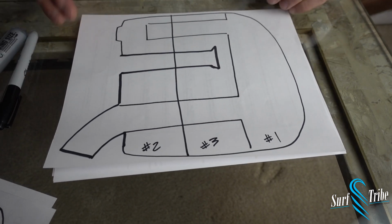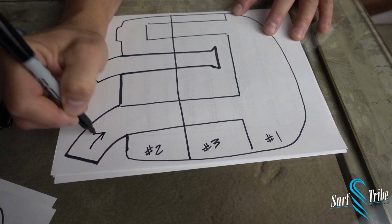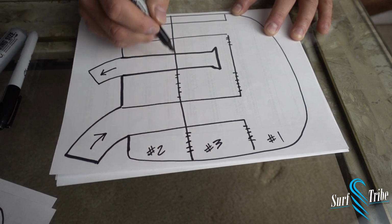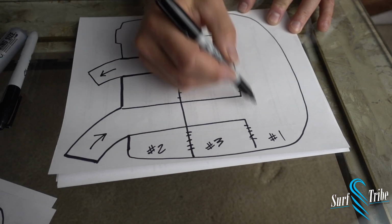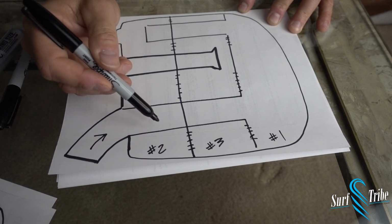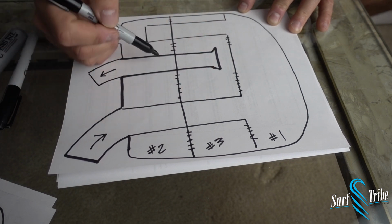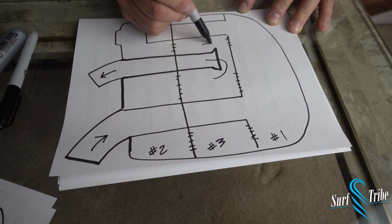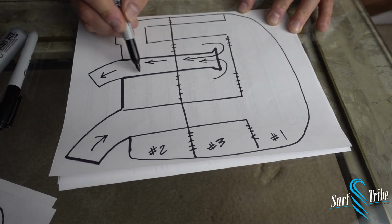Okay, so this is what the muffler looks like stock. This is the exhaust in, exhaust out. There are tiny perforated holes that start here, all through this. This is a chamber wall. Exhaust flows in, fills up chamber number 1, flows through this tube into chamber number 2, fills up chamber number 2. Now it can pass through all of these little holes in here. But the higher flow will come in, fill up chamber 2, pass through these holes in the wall, fill up chamber 3, and then out through the velocity stack, I believe is what it's called, and that exits the exhaust.